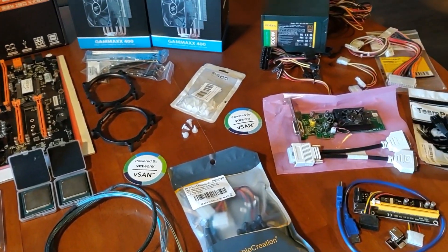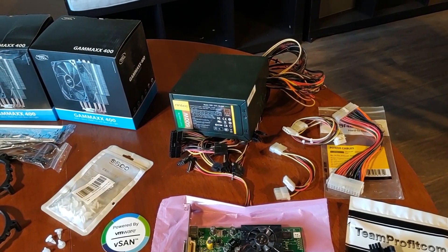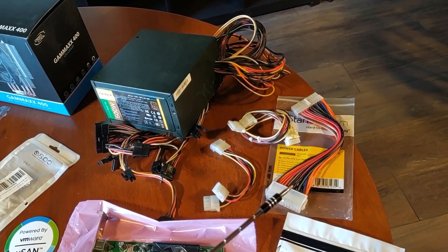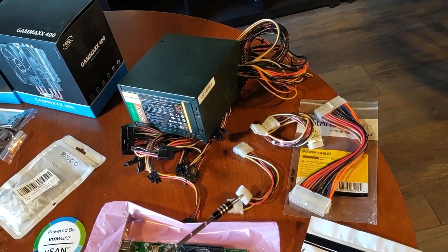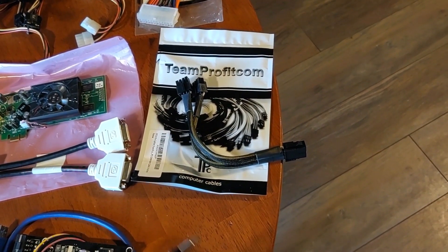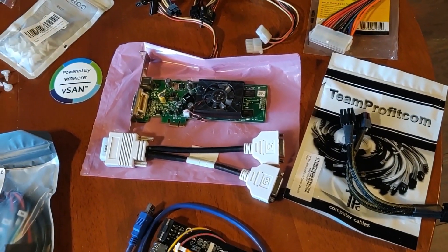Each build will have 128 gigabytes of RAM. For the power supply I've got an Antec 500 watt unit reused from previous builds. The 24-pin ATX connector wasn't long enough so I bought an extender — cheaper than buying a whole new power supply. I also had extra Molex 4-pin splitters for the drives, and I had to buy a splitter for the CPU power connectors since each CPU requires its own dedicated power feed.